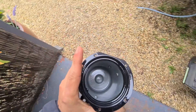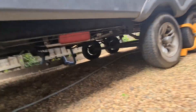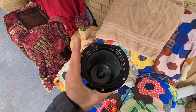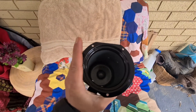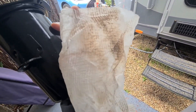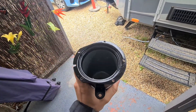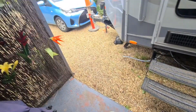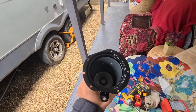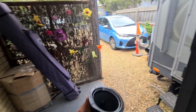Oh no, it's raining! And I'm going to fill it up with diesel from my tank under the caravan, because I don't have any other diesel anyway. I'll probably put the filter in first and then fill it up so I know what level it's at, and then reinstall it. This is the second piece of paper towel that I used — I might use one more even though it looks clean, because apparently it is not. I'm going to keep going until they stop coming out dirty. It is raining quite a bit — enough that I don't want to get water in this, so I'm going to wait until it stops before I close all that up and fill it with diesel.